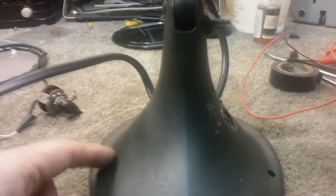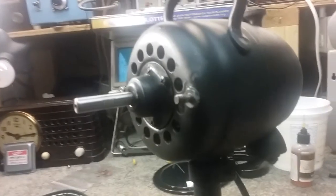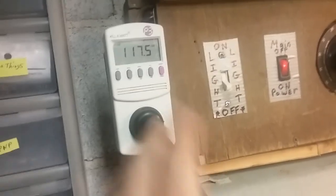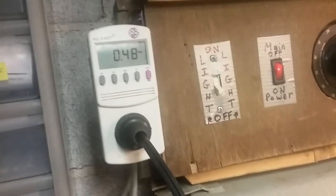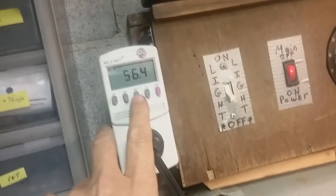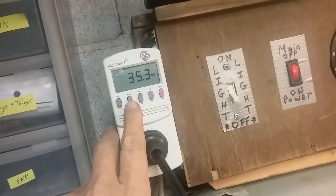Normally when you do a head wire, you make one coil in the bottom so you've got plenty of head wire for maintenance down the road. But rather than ordering a head wire, I just made do with what was there, because the customer said no restore — just get it working. Well, it's working. It's pretty quiet, got plenty of torque. That's high speed at 117.7 volts. It's drawing 0.48 amps — well under the rated 0.7 — at 36 to 37 watts. The efficiency is not bad, 56 volt-amps. Within tolerance.